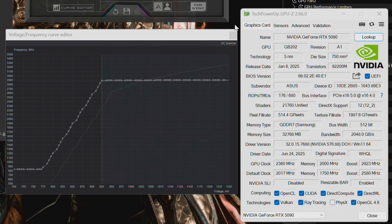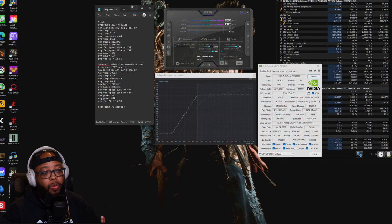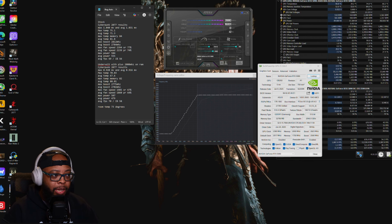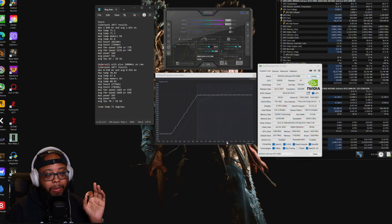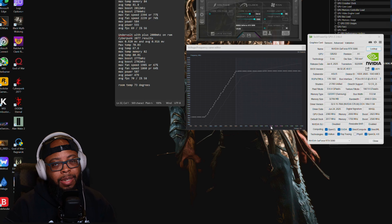Once you do that, all you have to do is start testing. I chose Cyberpunk 2077 to do my testing in. The reason is that you could use Unigine Heaven and run that, but if you're really trying to test the settings you just did, if you want to test out this undervolt, you need something that's really going to push your card. Cyberpunk 2077 really pushes it: I'm playing at 4K, high settings, I use DLSS with the transformer model, it's full ray tracing, path tracing. And it hits it hard.